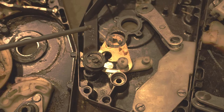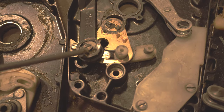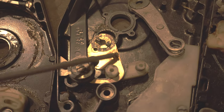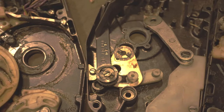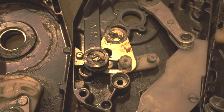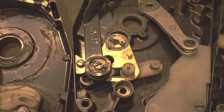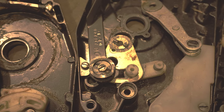One other thing I wanted to note is how the handle attaches to the inner part. There's a little groove right in here, and there are two tiny dimples on the inner piece. When the handle is screwed onto this, these dimples fit perfectly into those grooves. It's very important that the handle is screwed on perfectly tight, because if there's any play in these two dimples, not only will you wear them out, but the controller will not work correctly. Make sure this part is screwed on nice and tight with no wiggle room when you turn the lever.